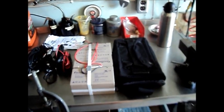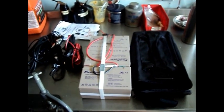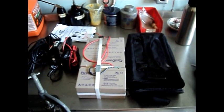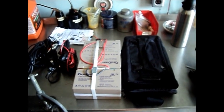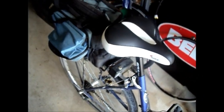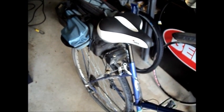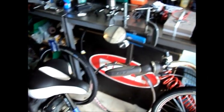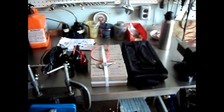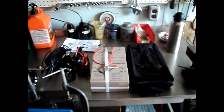The battery pack is 36 volt — three 12-volt 7 amp-hour lead acid batteries. Not a huge amount of capacity; I'd much rather have 12 amp-hour batteries. This one has been working quite well for the type of riding my wife uses it for. Sometimes by the end of the ride it's starting to get sapped out, but it's still working fine after all these years and still taking a charge. It is heavy though — I hung one on the scale a while back and it seems to me it was about 16 pounds.